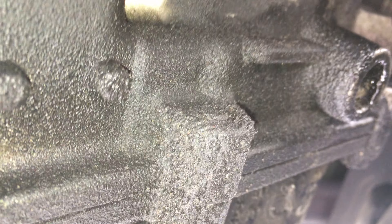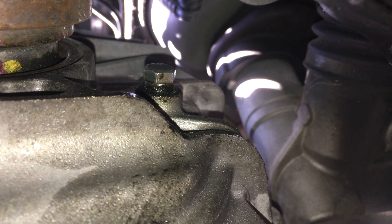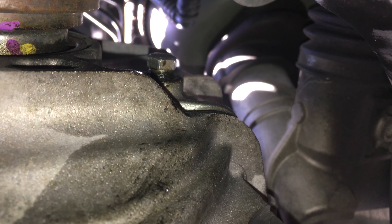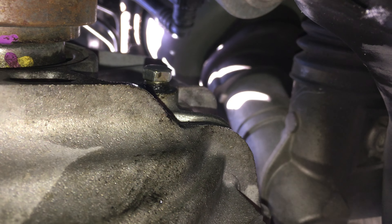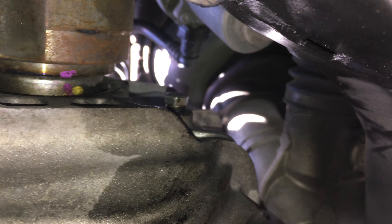There's a little tiny drain plug right there. Keep going and up there towards this pipe thing — it's hidden — there is another little tiny bolt right there. They're both the same size, 7/16 or 11 millimeters. That one you just keep out while you're filling it up, and when it's full it should be seeping out of there. I drained mine and four quarts came out, so I just put four back in and a little bit extra, and that's really it.